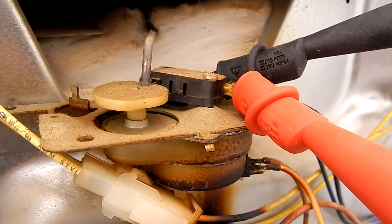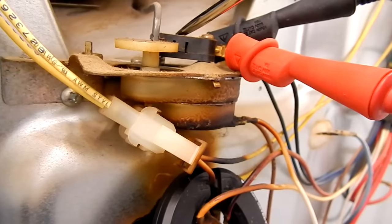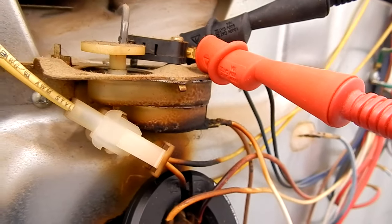Basically that's how you troubleshoot the parts — there's not really a whole lot to it. We verified voltage came from the relay down to the motor, the micro switch was good, and the door switch itself on the front of the stove was good. This stove was a Whirlpool, and they're all going to be basically the same, so this should help you troubleshoot and get your stove back up and running. Thanks for watching and good luck on your repair.